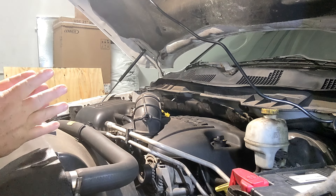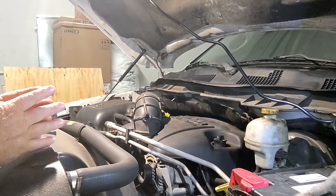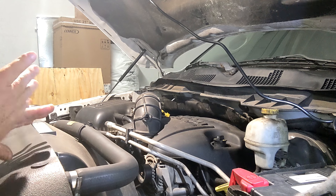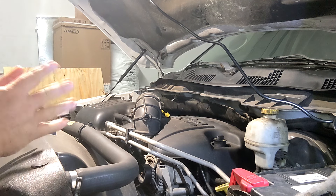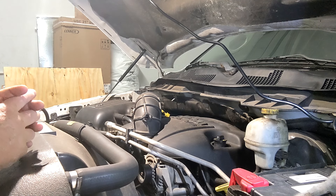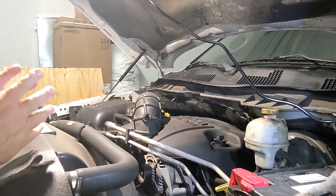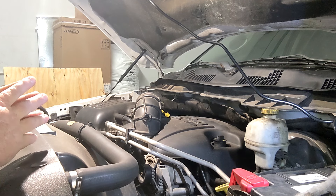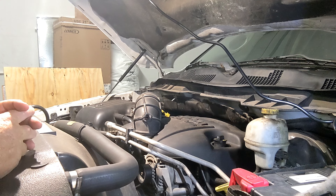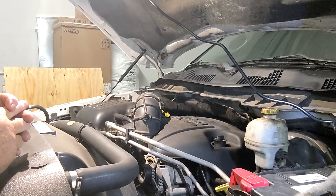What I've got going on is some extreme hesitation on acceleration, and sometimes the idle is kind of funky. The little blade inside there gets all goobered up with some kind of grime. Back in the olden days they called it cleaning the carburetor, but on these modern cars you have to clean these throttle bodies out sometimes. I'm going to pull this off and see if that's indeed our problem.